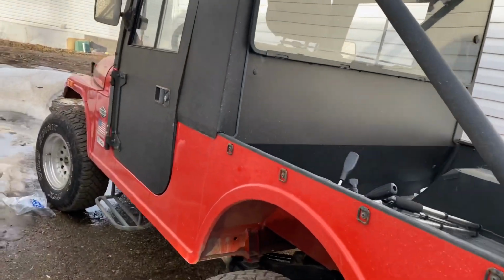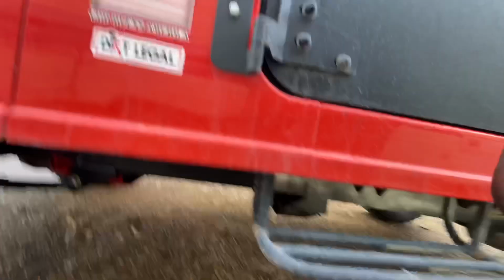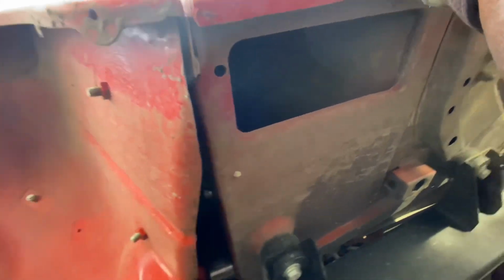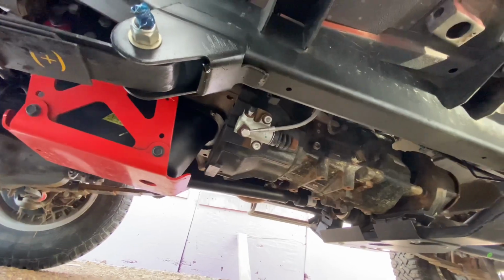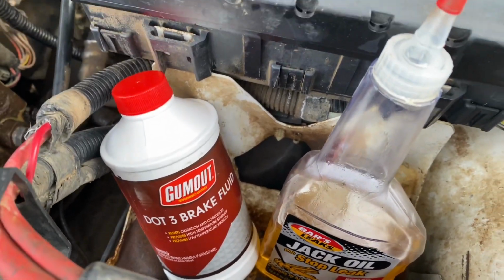This is kind of an unusual video. It's about... here I'm just showing you something real quick before I jump into the subject matter. Underneath the Mahindra Roxor, look carefully below the beam. You see right there, you can see the slave cylinder for the clutch mechanism. It's external. I believe it's just held there by two bolts. So if that fails, you take two bolts and out it pops.